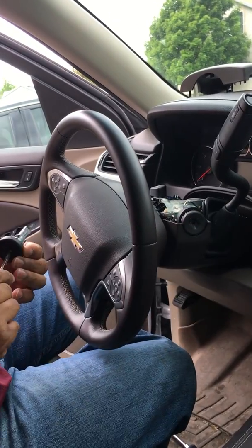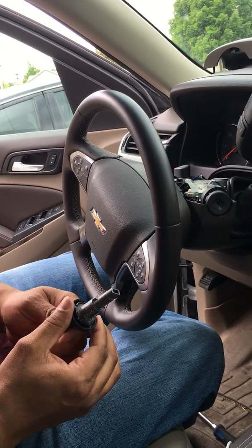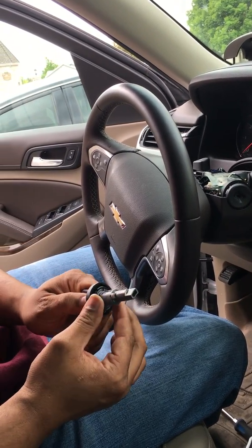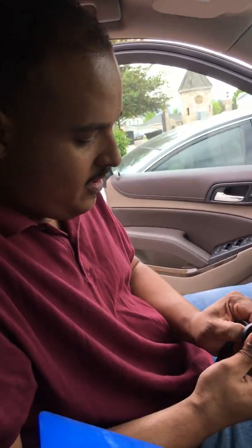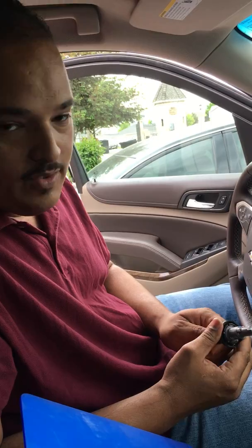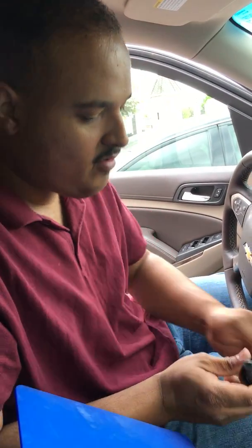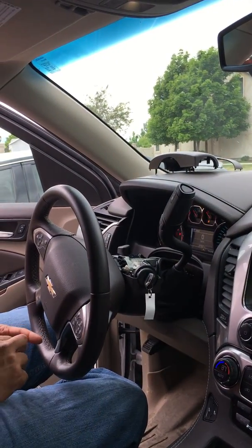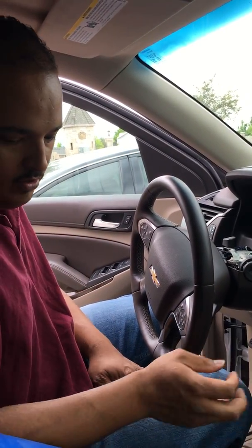We can go through with the Tech 2 on the web, TIS2Web, and dump the key if we wanted to. I don't have a subscription for that — I'll probably have to pay for that to also program the remote, which we're going to cover in a minute. So if I have to pay for that, it's fine. The replacement key I have does work to start the vehicle, but it won't operate the door until I replace the door lock.